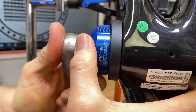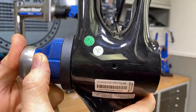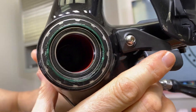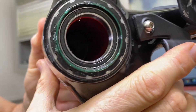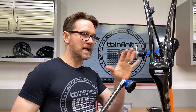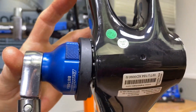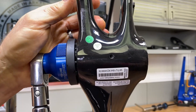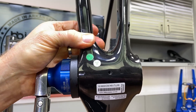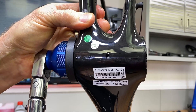This is a nylon tool and it will do 30 Newton meters without a problem. But if you start skipping around, it could strip it out. We're almost home right there and that's it. Now we're going to snug this up and torque it. We want to maintain a lot of pressure on this because this flange is not real thick right here. Get the tool on there just like that and maintain a lot of pressure — we don't want the tool to skip and come off. Stabilize it as we're turning, and there we go.